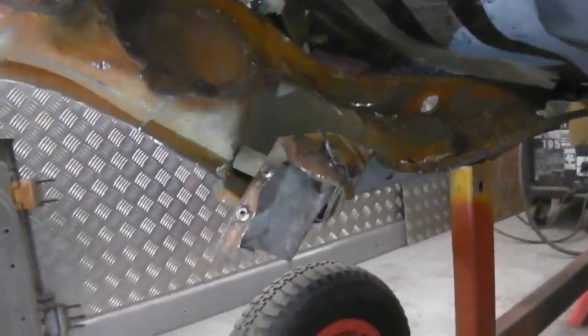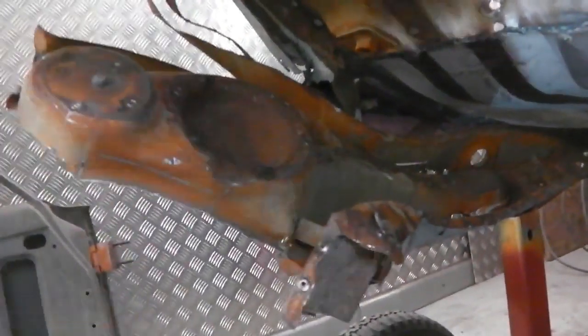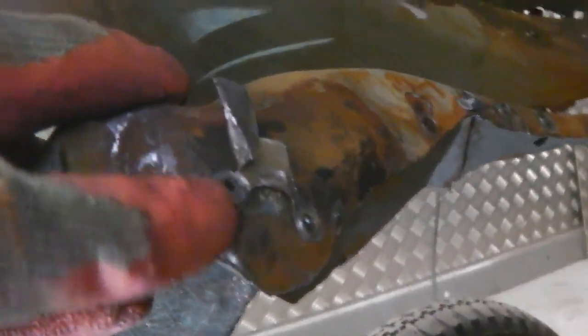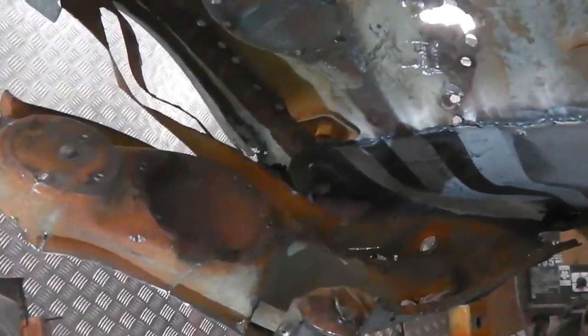So we got the main piece out. As I say, when you're not reusing the panel, you can speed the job up and cut into it and get your chisel in at the side. If you're breaking the piece apart, you can see the weld gone. So it didn't matter if we made a couple of incisions to speed the job up. I had it starting to go down that side nicely. It was going down here nicely. Then it hit a stubborn spot just there, and then it hit a cluster here. I'd got all four. There was one, would you believe, and it took a big piece of metal with it when I slid. See, just got it at the end. See how that spot weld almost got it, but just caught it on two together. Stuff like that can catch you out. So it's gone there, anyway, because it's completely rotted itself away from the rest of it, and it's ripped out. So we'll take the leg off as well. Right, a couple more little slices and that's away.